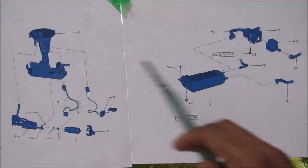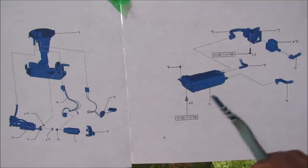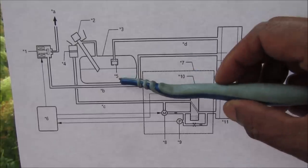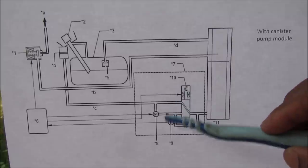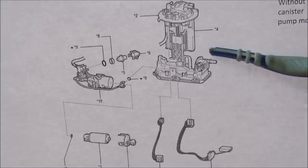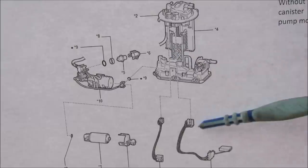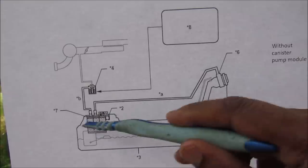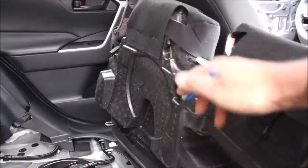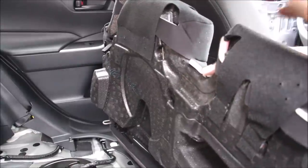The RAV4 has two unique types of fuel systems. The first has a traditional canister and a leak detection pump situated outside of the gas tank, with the pump inside the gas tank. The charcoal canister draws harmful gasoline vapors out of the fuel tank, and this system has its own vacuum pump to ensure there are no leaks — otherwise it'll throw an engine code. The other style of fuel system has the canister located on the fuel pump subassembly itself, submerged in the fuel tank, forming a self-contained system — the vapors then just go through the purge valve to the air intake. As a little cost savings, instead of using a sponge with a wire frame seat it actually just uses styrofoam backing with a very thin sponge on top to make it feel soft.